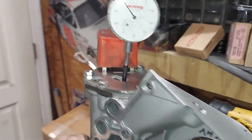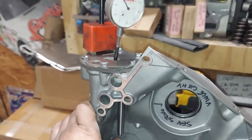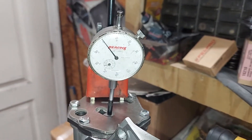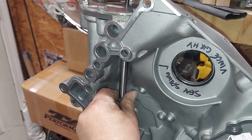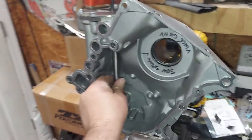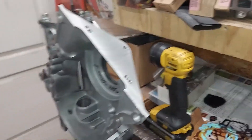Here's another check — this is a thrust plate. The thrust plates on those are torqued to 140 inch-pounds, so this simulates everything. We're going to check our end play: that's right at a thousand — that's beautiful. However, it's getting tight, so we can't let that fly.